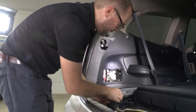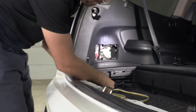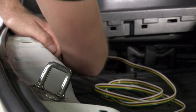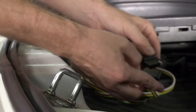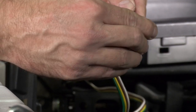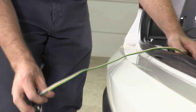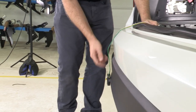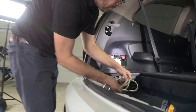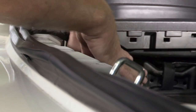With our ground wire connection made, our fuse in place, and our harness installed, we're going to take this adapter box and tuck it back here out of the way behind our jack. We have our four-way lead — I'm going to put the dust cover on to keep the four-way flat lead nice and clean. When towing a trailer, we simply take the lead out through the hatch and close it, using it to connect to the trailer. When not in use, we simply coil the lead up and stow it here in the jack compartment, safe and out of the way from cargo.